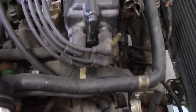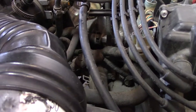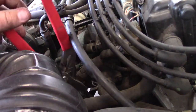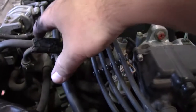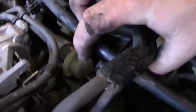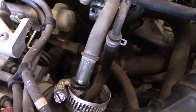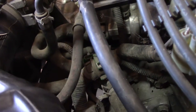In the spirit of replacing the hoses while in here, we'll get the lower radiator hose now. In the camera view it seems buried in there, but in real life it's a lot more obvious — the hose runs from down there right into there. The clutch cable is just a little bit in the way, so remove it from its bracket to give it some play and get your wrench on the clamp.